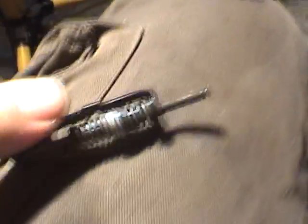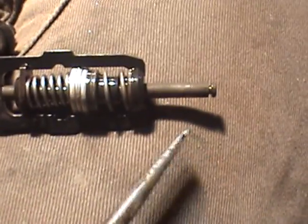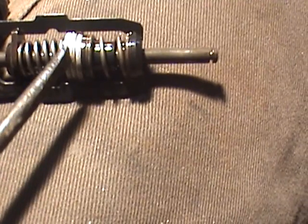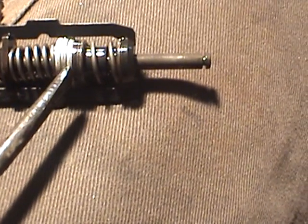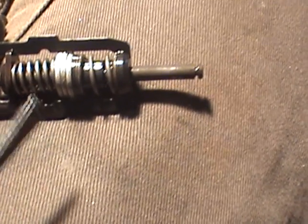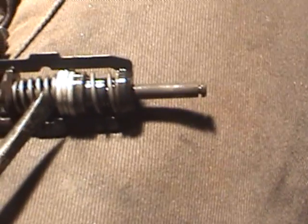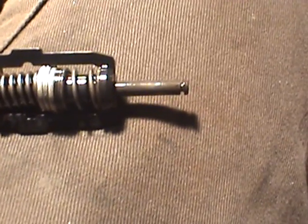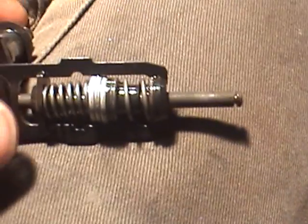There you have the governor inside the pump. This is the governor here. That's the main spring there. You can see the three washers that I've inserted there to put a bit more tension on that, and that will ensure that the fueling isn't restricted higher up in the rev range.